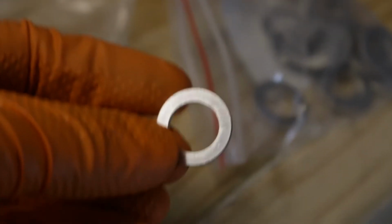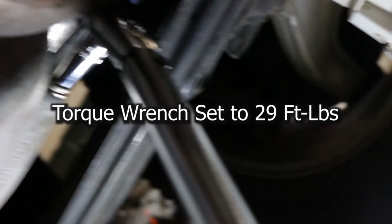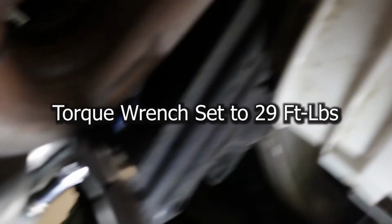Install the drain plug with a new drain plug washer. The recommended torque is about 29 foot-pounds.